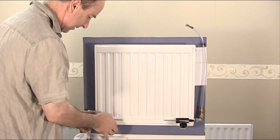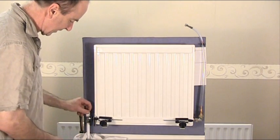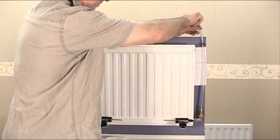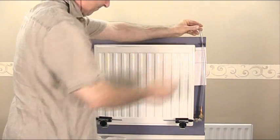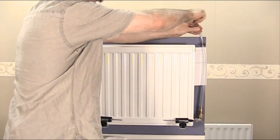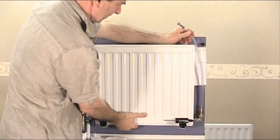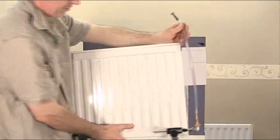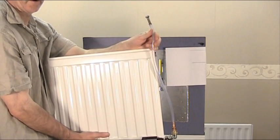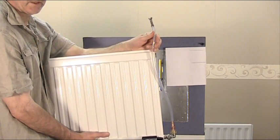Then push it over that way and tighten up the pinch screw - that will hold the water inside the radiator. So you can see there's a gap there, it's actually disconnected, the water level is still here. It's vented now to atmosphere but the water is still held inside the radiator. So what I can do now is take the radiator off - you can see the water level there - take the radiator off and that's it, the radiator is off with the water still inside. So that's a quick demonstration of how to fill, vent and remove your radiators using the rag clamp system. Thanks for watching.